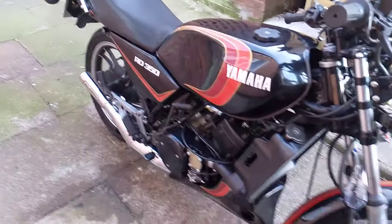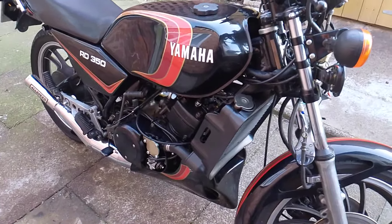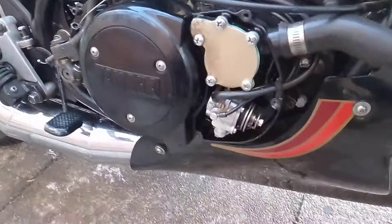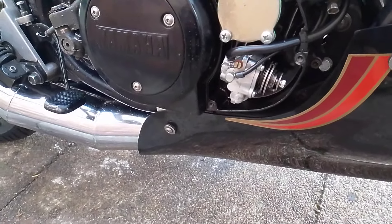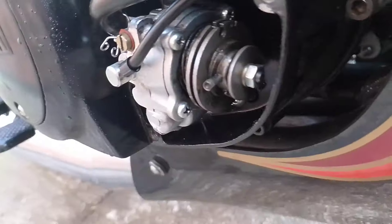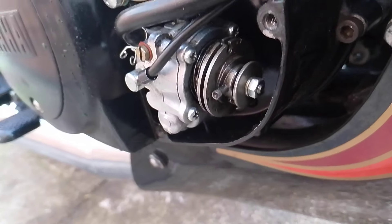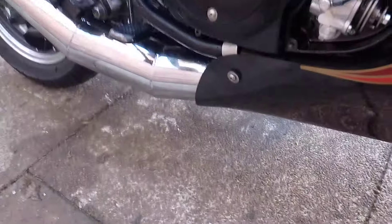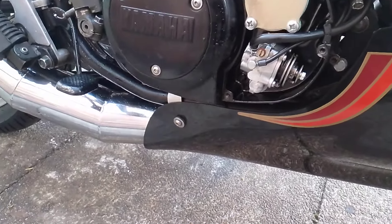I haven't checked for sparks on it yet but I'll do that. I'll have the tank back off later and see if it wants an air filter. I'm going to pull the oil pump off it because after yesterday looking at what the carbs were about, I'm not sure that's a 350 pump on it. There's no red or yellow dot anywhere on it — red's 250 and yellow is 350 — so there's no distinguishing mark, I'll have to pull that off.